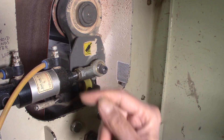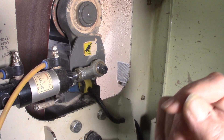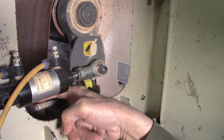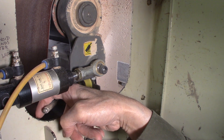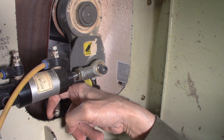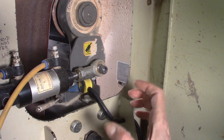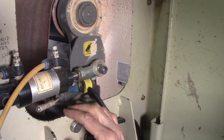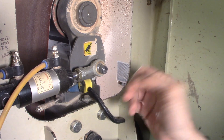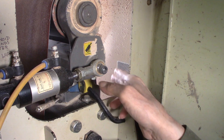That mechanism can fail — it's a very delicate system. Dust can build up on that and make it think the belt is still in the way, in which case the belt is going to keep going and hit the equivalent stop piece on the other side. If the belt hits that and turns it far enough, that is going to stop everything — it will turn itself off before the belt tears itself to shreds. It will then keep going occasionally because it doesn't know the belt has left, since it's darkened by dust.